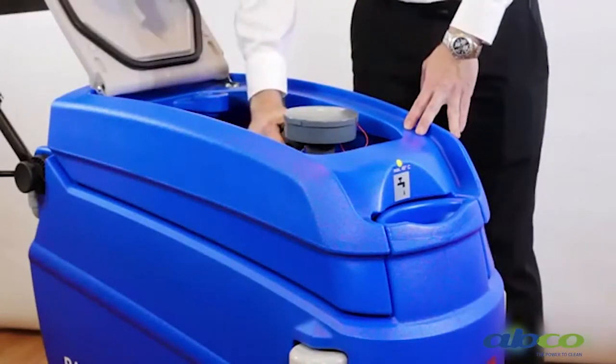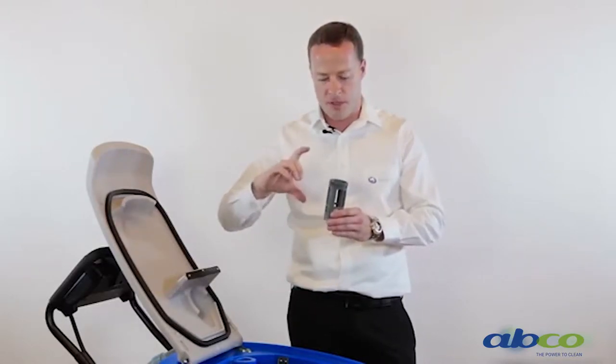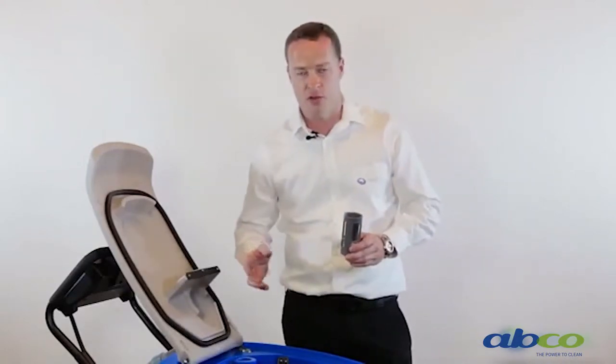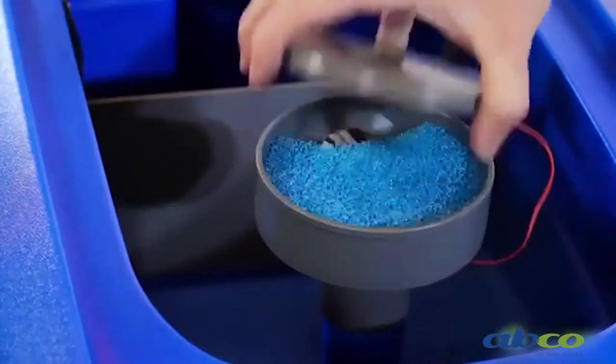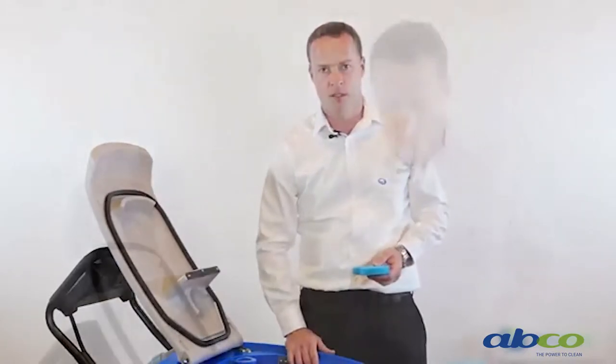On the vac motor, as the water comes up, we've got a ball float. The water will come up and pick up the ball to block off your suction. But foam is a lot lighter than water, so our water level may be down quite low — our foam will come up, will not pick the ball up, and could end up into your vac motor. Please note, if your vac motor does fail due to moisture, this would not be covered under warranty. Also in here, we've got a filter for your vac motor. This needs to be checked after every use. Pull it out and clean it — it can be rinsed under a tap. We recommend keeping it aside overnight before putting it back in and making sure it's fully dry. If you feel there's a little bit of moisture in there, just turn your vac motor on and let it run for about 30 seconds without any filter in, and that way it'll burn out any moisture.